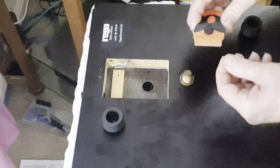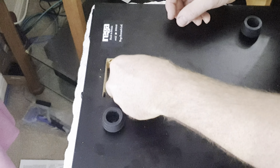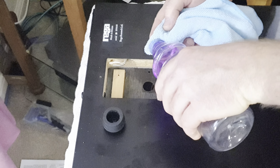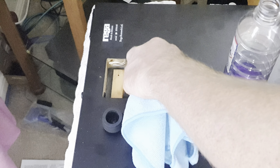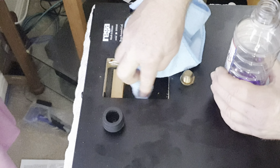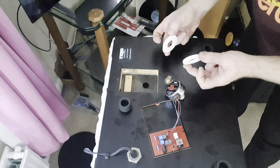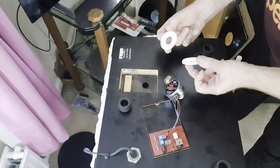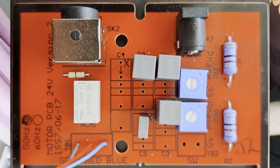Use a new craft knife or a small plastic scraper to make sure there's no dirt on the back of the substrate, blow it off, then use a little methylated spirit on a clean microfibre cloth — we're going to stick down some circular foam pieces so we want the best possible adhesion. Leave it to dry for a few moments. Before peeling and sticking the foam pads, check that the frequency marking on the board in the kit corresponds to your local mains frequency.